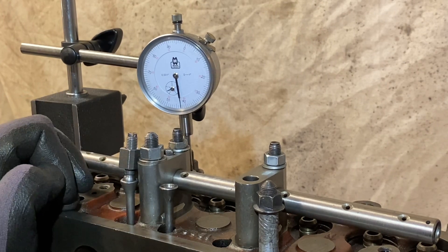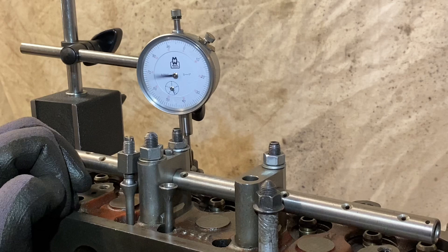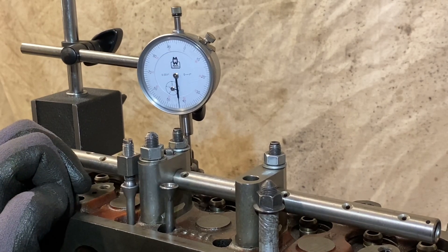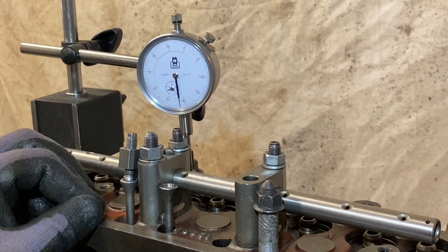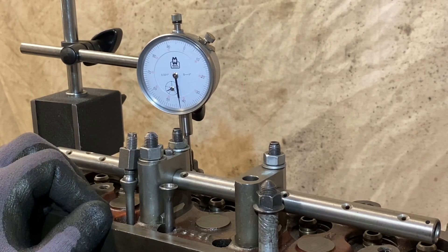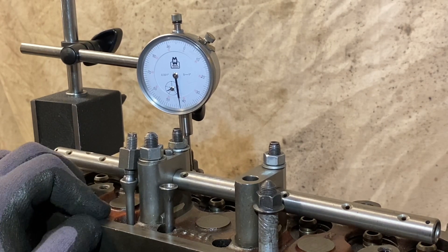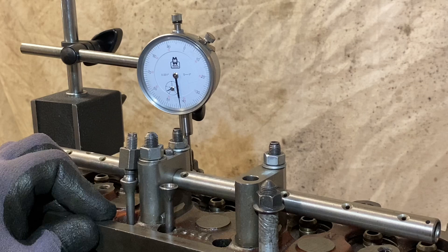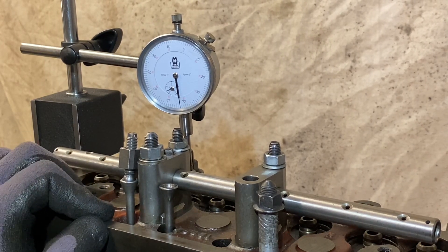As you can see, that's now up to 357 and a half. So what we have to do with all these rockers is we don't just make and machine them — each one has to be put on the jig, verified for its lift, and then adjusted to make sure it meets the specification. There's 100% inspection on all these rockers because every single one is checked and adjusted.